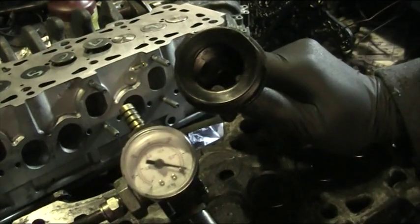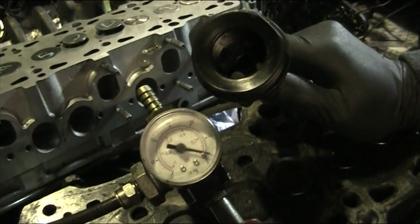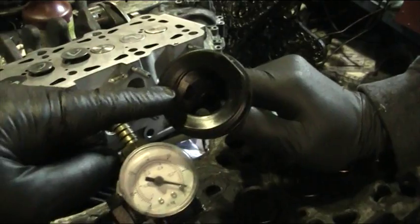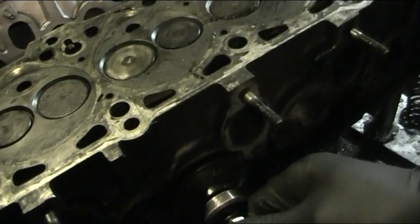What we have here is what we call a vacuum valve tester. This vacuums the air out of the ports when the valve's shut on a cylinder head. This is the gauge that tells us the reading. There's a long pipe and it comes back up to this suction cup. You fit the suction cup onto an intake or an exhaust port, which T's just about to do, and you pull the trigger.